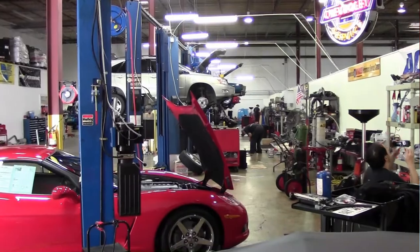Are points and plugs the same — as needed? As needed, or maybe once a year have somebody take a look. It really depends on mileage. A lot of people in C1s and C2s probably don't do 5,000 miles a year, but if you get away from the mileage and the car sits, you can have problems with points and things. For the third generation — any changes? Just about the same. We can run premium gas in those cars. Any time you can find a local place that has non-ethanol is ultimately the best thing to run — ethanol really chews up the carburetors on those cars.